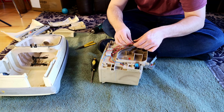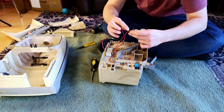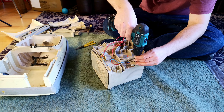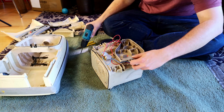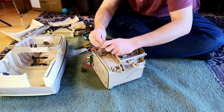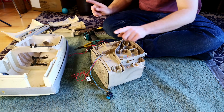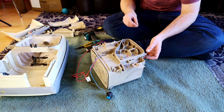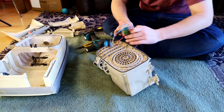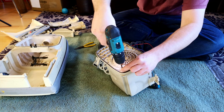We need to take off the red wire from the switch, which also goes to the motor — in fact, both of these really go to the same place. What we should take off is the one screw holding the switch into place. We can probably get away with doing nearly all of that — if we take off the red wire from the cord rewind, we have our wires going to the motor and nothing else really needs to come apart. For the purposes of this motor refurbishment, we can undo these four screws.